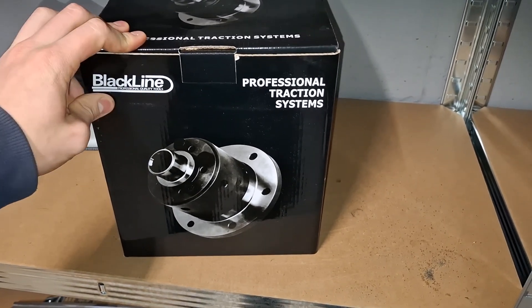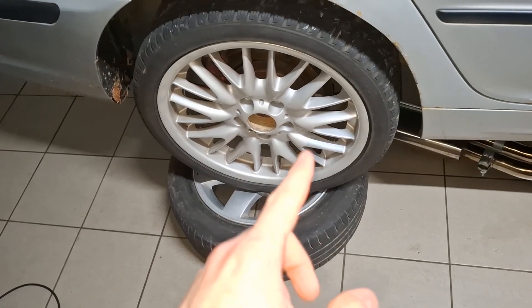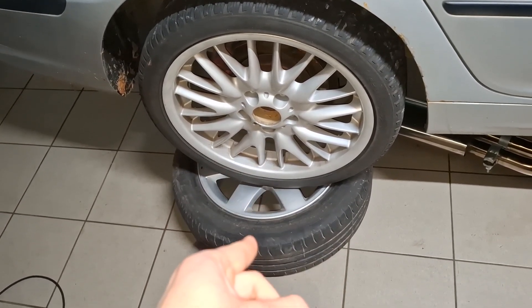In the last episode, I actually wanted to install a similar unit into my E34. I unfortunately learned that the longer gear ratios from the TD and TDS models have a different gearing offset and therefore are not compatible with the LSD unit I bought. What a bummer. My brother bought a similar unit for his car, which is what we're going to install today and also do a teardown of the failed racing diffs conversion set. We'll also give you a quick rundown on what the failed set actually looks like from the outside, because one wheel can be turned while the other is on the ground.